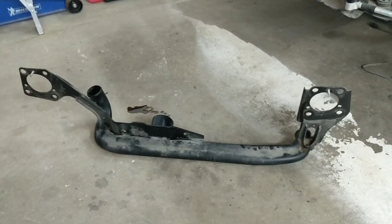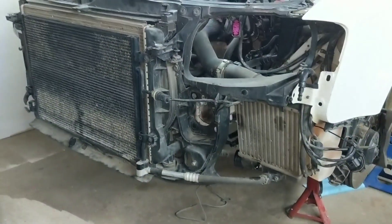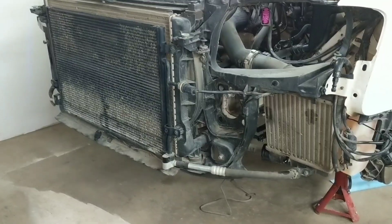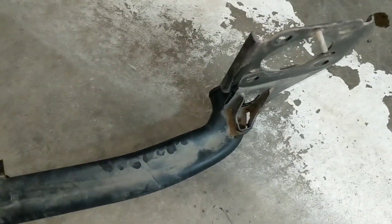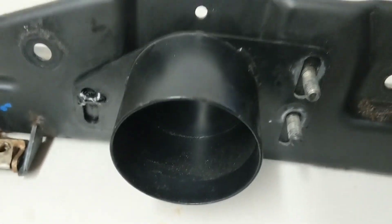There she is — got it off. Point proven that you can take out your lower core support without removing anything else from the front lock carrier or removing it entirely. I really did not want to touch the AC system, but it worked out. The final step was just a matter of shimmying it out from between the crash bar reinforcement and the back of the lock carrier. The unforeseen trick was getting this bolt to go behind everything as it slid its way down through the section, but it came out. And as you can tell from the oil on the ground, this integrated piece of airflow from the two side mount intercoolers had oil in it too.